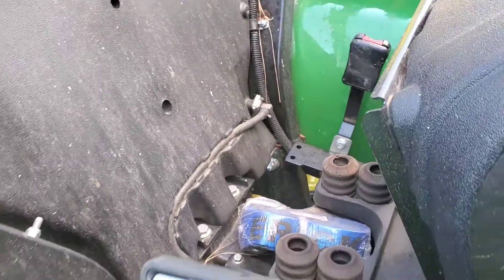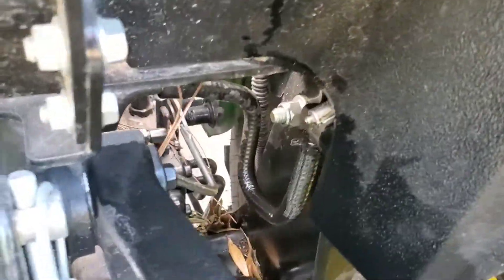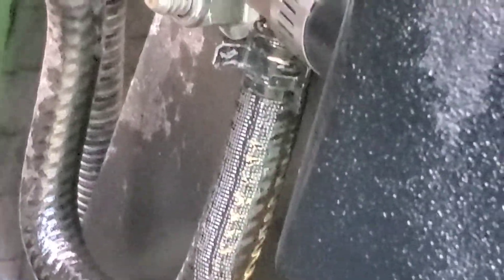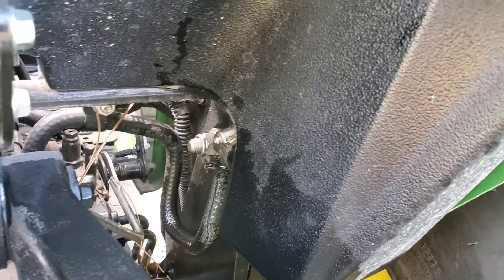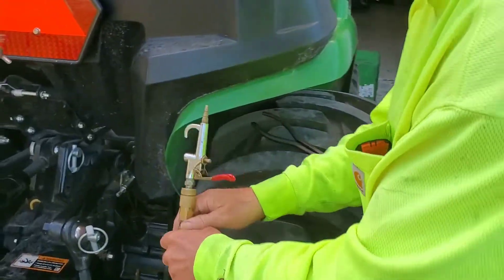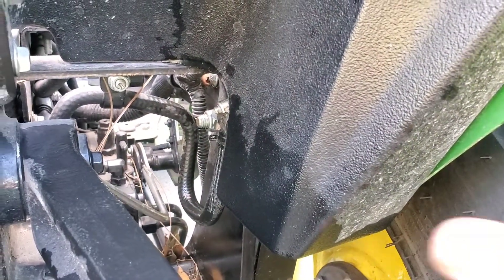So I come around to the back here and take this hose off the bottom of the fuel tank. When I popped this hose off I didn't have any fuel coming out, and I've got about seven gallons in there. So what I did was stick an air hose right up in there where I pulled it off, gave it a couple blasts, and I started to have fuel gushing out of there — which confirmed that I could have sediment in my tank.